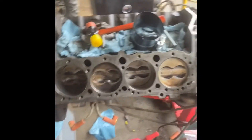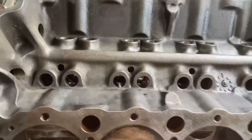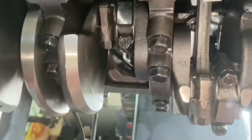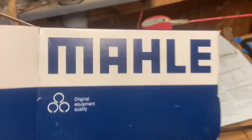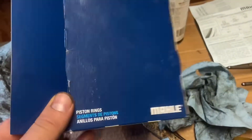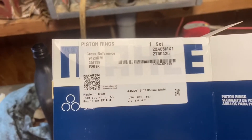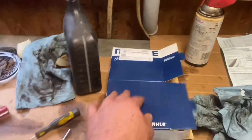Bowls, blood, sweat, and tears — we now have all eight pistons in with fresh rings. All eight are in there, they just need to be torqued down. We ended up going with Molly rings — they're supposed to be pretty decent and a lot of people run these. These are for a 30-over bore, which you can see marked on the pistons.